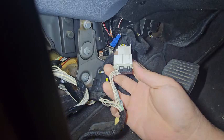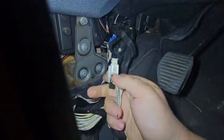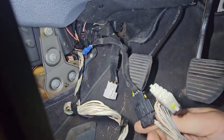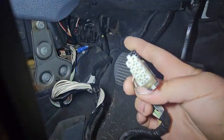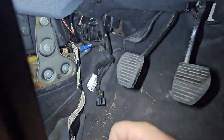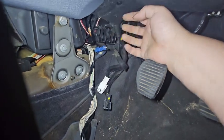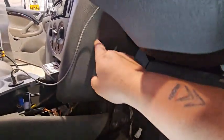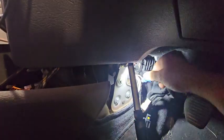These particular ones are the cables for that bloody annoying Traffic Master. What you need to do is unplug these. What you want is the male end, which is this end — this needs to go back up towards the radio. This side, however, you can actually cut off. But before you cut it off, there is a little gap just up where my fingers are — like a channel. And the channel actually goes all the way up to the side of the dashboard to the stereo. There's just a little channel where you can push the wires up there. This other wire here goes to the LED light. And there is another plug lurking about somewhere for the switch.